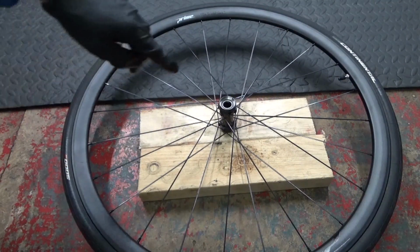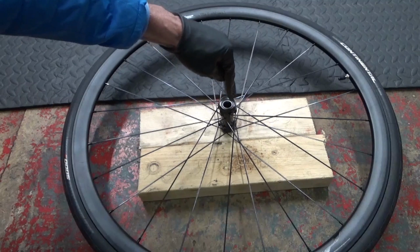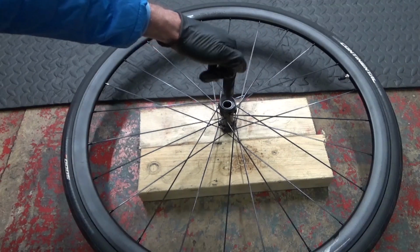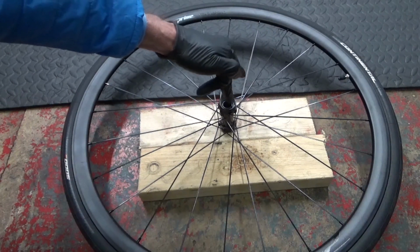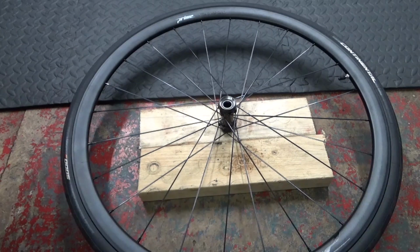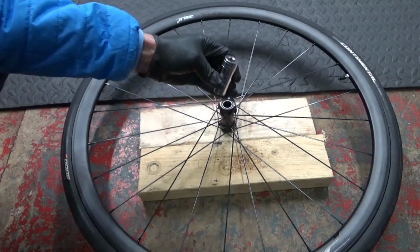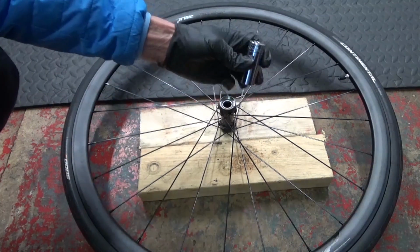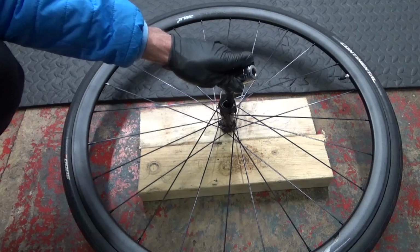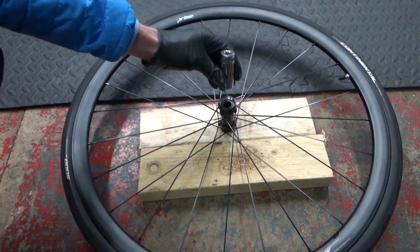Now if you want to go out and buy a press to put it in with, if you haven't got one, then you need the correct size adapters for the bearings. I'll put the size of the bearings in the description so you know what to purchase. But like I say, if you're going to buy a press, you need the one with the right adapters for these actual size bearings. Now if you haven't got one, what you can do is get yourself a 19mm socket, which is exactly the same size as the outside of the bearing. Never hit on where the seal is on the bearing, the black seal or the coloured seal, whatever you've got on yours, because you'll ruin it before you've even put it in.